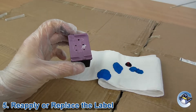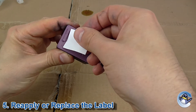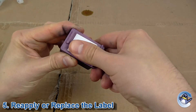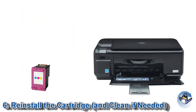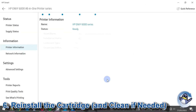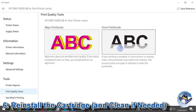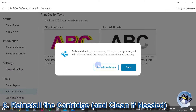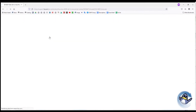With the cartridge refilled, either reapply the label or pop a small piece of tape over the holes. Try not to make the tape too large or overlap the edges as it may prevent the cartridge from going back into the printer correctly. The cartridge can now be installed into the printer again. However the ink may need a helping hand getting where it needs to be within the cartridge, so I'd recommend running a cleaning cycle from your printer or printer software and then checking the results. You can always do more cleans to pull ink through if necessary. If you do not know how to run cleans from your printer, please check your printer manual or one of the many video guides we have on YouTube.